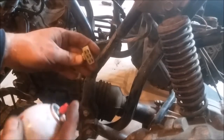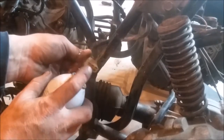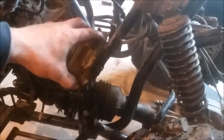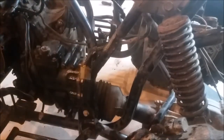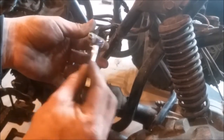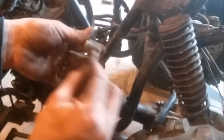Just to avoid future problems with the wiring, we should probably clean out the connectors and terminals with some electrical cleaner. Now that it's all dried off, I'll put a little dielectric grease on there.